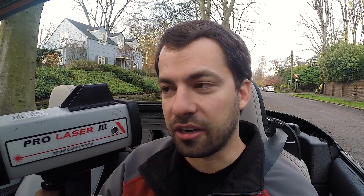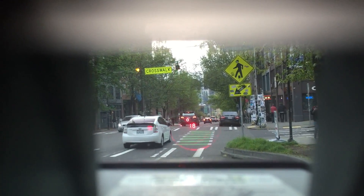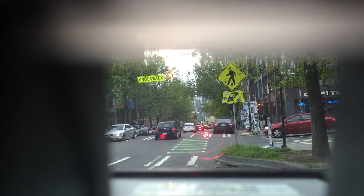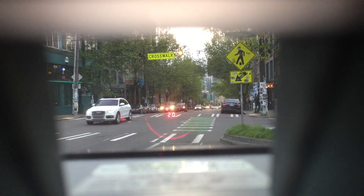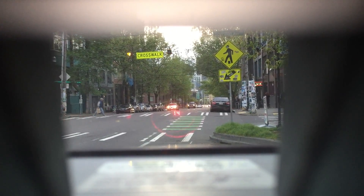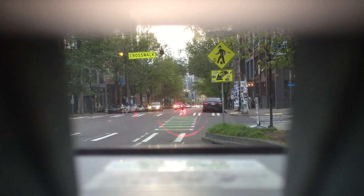Laser is a little bit different. When a police officer is using a laser gun, they're able to pick off one car at a time and selectively choose which car they want to target. Because a laser beam is so thin and tiny, they can be targeting one car and the car next to them will get no alert. Additionally, if they're aiming for the headlights, grill, or front license plate area, even if your radar detector has a laser sensor built in, because it's mounted up high on your windshield, there's a very good possibility it's not even going to alert in the first place.